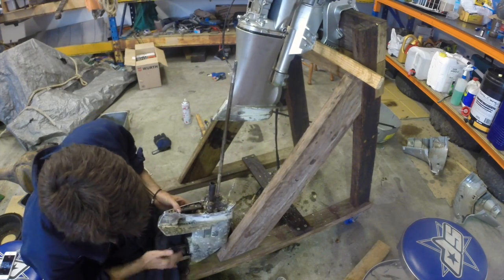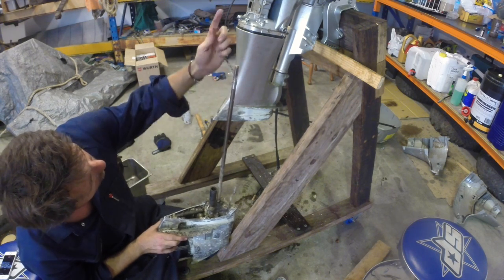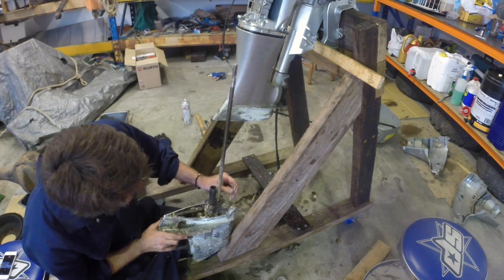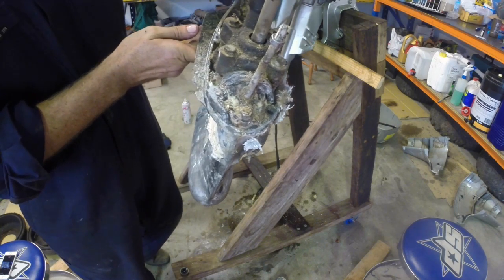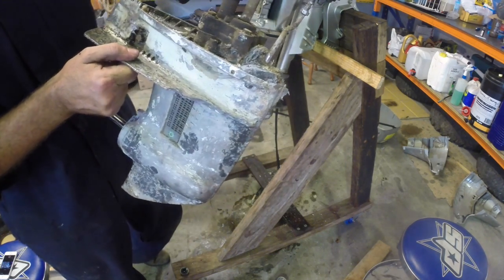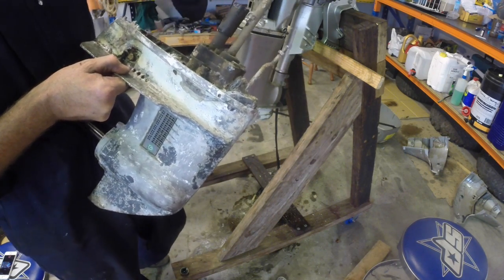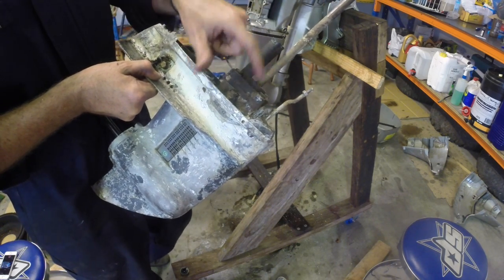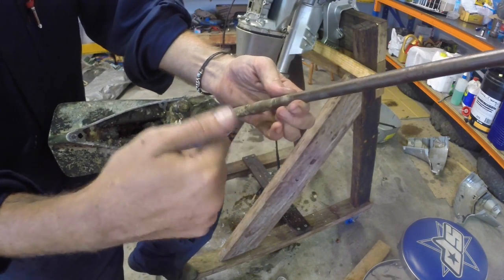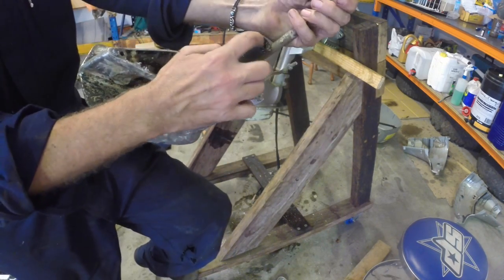This is the foot. The prop shaft you've seen. This is the water pump that cools the motor. This is the drive shaft - this splined shaft slots into a female output shaft on the crankshaft of the outboard motor. And this is the gear selector that comes up and down. There's a tube coming down from the water jackets on the outboard - as you slot the leg up, that tube slots into here. This is the water sucked in from these grills, and this is where it pumps up to the outboard.